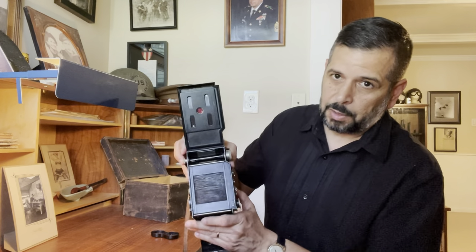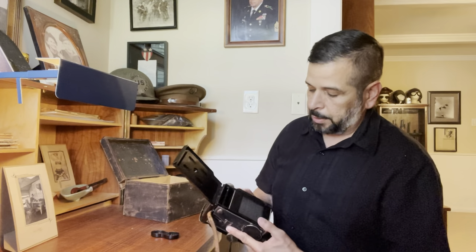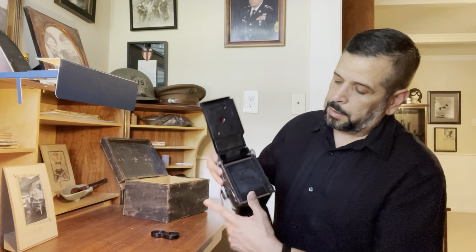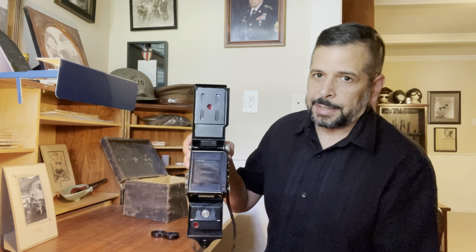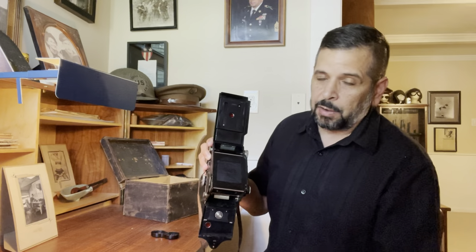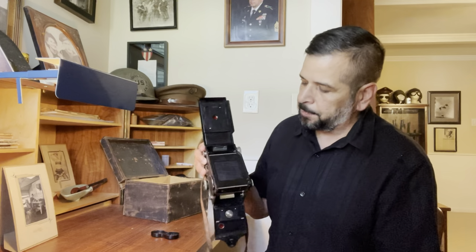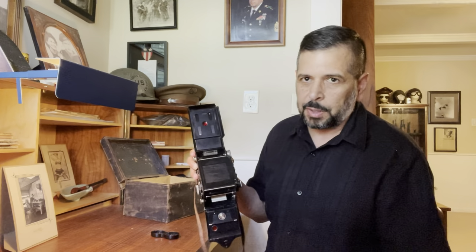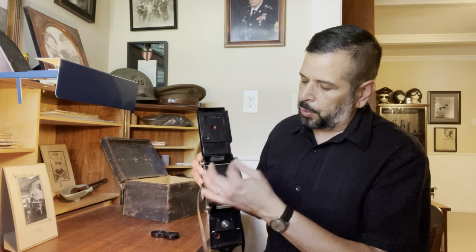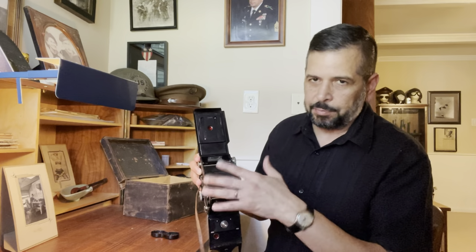As far as I can tell it's going to function fine. The next problem is that the shutter curtain material is deteriorating and flaking off, developing microscopic light leaks. I've been going over it with a paint pen — I'm told it won't work long-term because the paint won't be flexible and will flake off — but maybe it'll work temporarily. I've been going over it trying to get it light-tight again, and I think it's pretty much working.